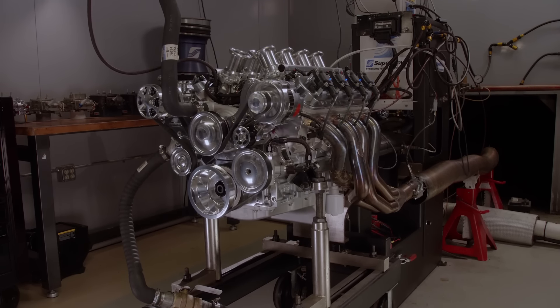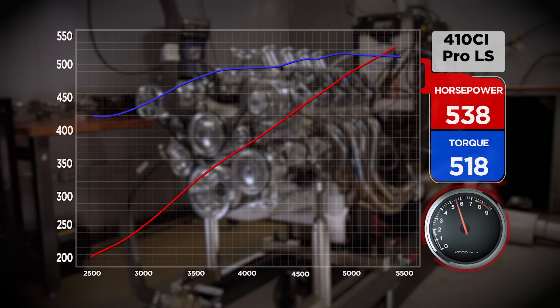With the ITB, everything was actually relatively simple to set up. We love dynoing with a full accessory system — it gives us a true number, like this thing is ready to go in the car, so this is what it'll make. The stack injection looks awesome. It's all pretty new but so far it's very smooth — it runs great. No hiccups. The preliminary pull shows 518 for torque and 538 for power stopping at 5,500 RPM, and the power is still trending up. Oil pressure is 70 PSI at the top of the pull — that looks great. Air fuels look good side to side and holding pretty steady all the way through. We're going to make a real pull.